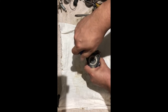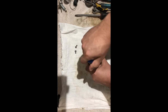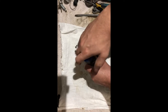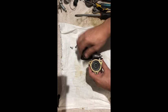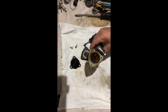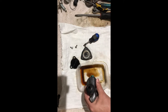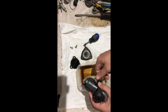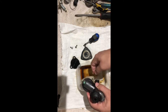We're probably dry, but we'll see what it is. It's still got some in there, but it's not good looking, so we're going to pour all that out. While we've got it hanging over, we'll pull the banjo off. Some of the fluid should have come out when you pull the banjo off out of the brake line.